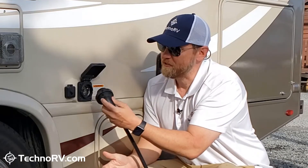There are also some usability issues that if you talk to enough RVers who use this style plug, you'll hear about — just making sure that this plug is installed properly. Because of the twist pins, it's not always a given that you are plugging in correctly and making good contact between the plug head and the electrical pins.